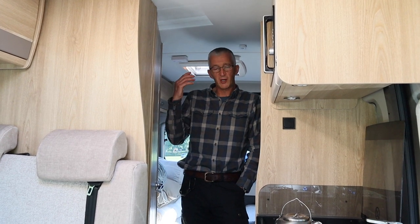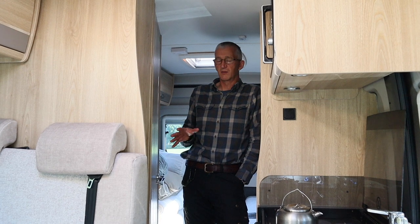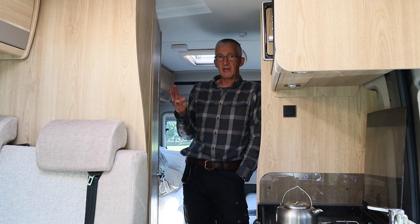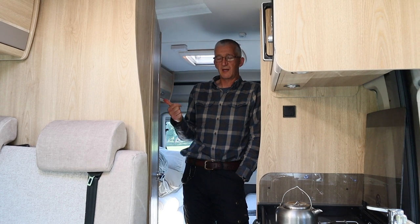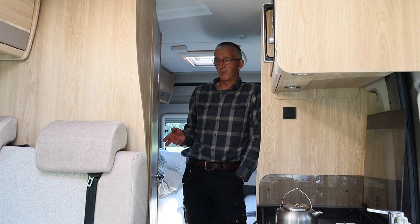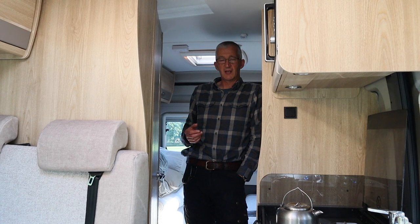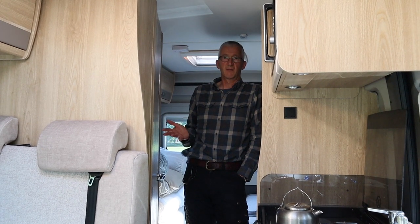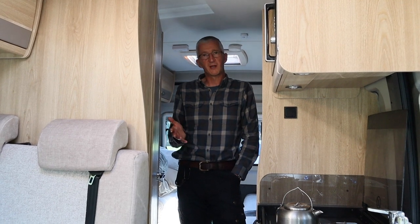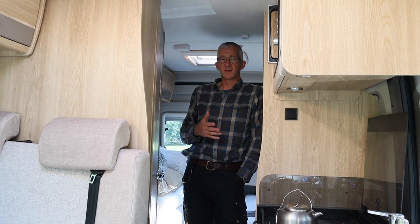Also, when we're showering and things, because we have grey water, there's a wastewater tank here, so moving away from the toilet tank, there's a second tank. So there's three tanks in this. There's a clean water tank, there's a grey water tank, and then there's the effluent that is generated from the toilet. The grey water tank, it's fair enough to empty that down a drain, providing you're not filling it full of chemicals.